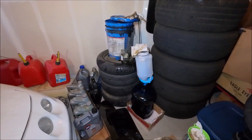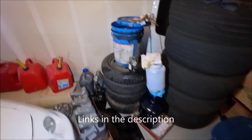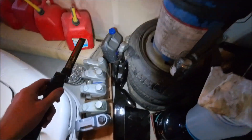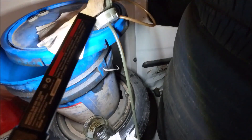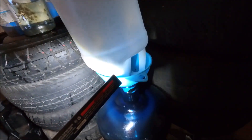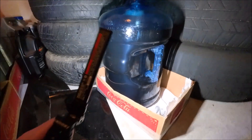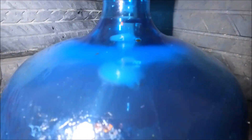At the end of the video I'll show you how I made this, but for now I'll show you how it works. You got your waste engine oil right here — you pour it in, you siphon the tube, it goes through these filters right here, down the funnel, and into the bucket or container. So all of this is clean and ready to go.